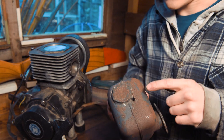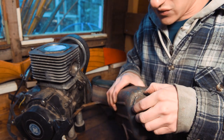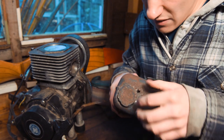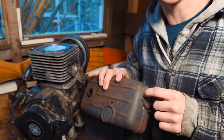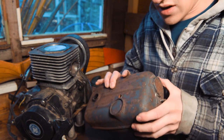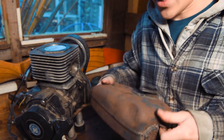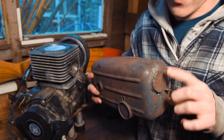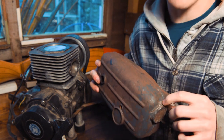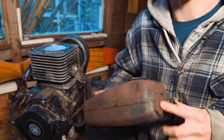The next issue I've got is this top piece here has been sealed up with some exhaust putty by the looks of it. It might well be the old weld, but I really doubt it — I think I can see a bit of a fingerprint in there. So that's obviously leaked at some point in its life. When I clean this up with a wire brush, I'm going to run over that a bit heavier to try and remove as much as I can and then reseal that before we paint. Let's go over to the wire wheel and get this thing sorted out.